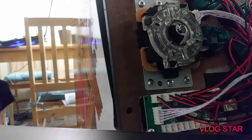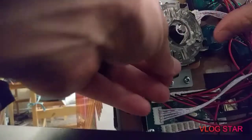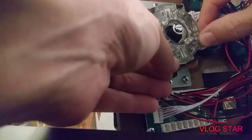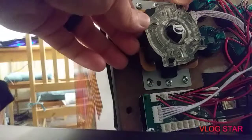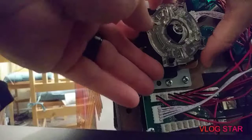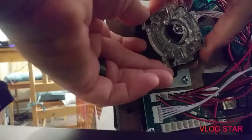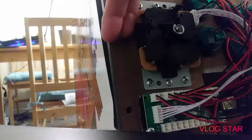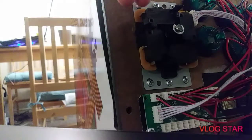There are four different tabs — I'm pointing at them here — and you want to press them in. Press both of them at the bottom at the same time, let it release just a little bit as you press them in. The plate will release off of there, and they all have to be kind of even for it to come off. Also have to be careful of the micro switches — these things right here — so just have the control panel tilted back so that they don't fall forward.